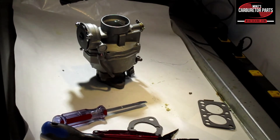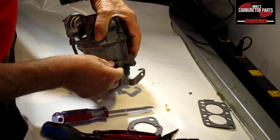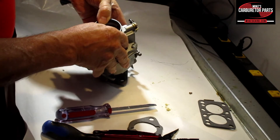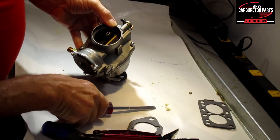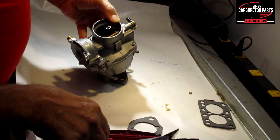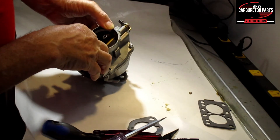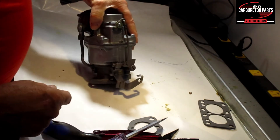The next setting is the choke rod. This rod right here — you're going to have to get this off the table. Put it on the second step on the fast idle cam; that's your idle screw, just stick it on the second step. Close your choke by pushing it with your fingers — see, it's already closed here. You want to measure this little gap at the bottom of the valve; there'll be an opening. You might need a paper clip or something like that to get down in there. Measure that gap and set it by bending the rod more or less.